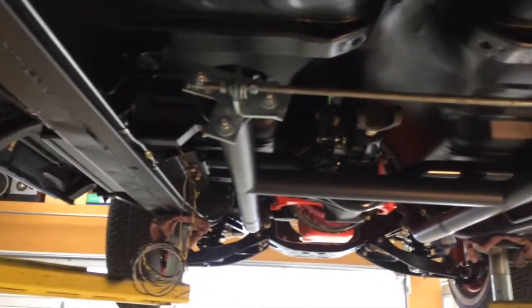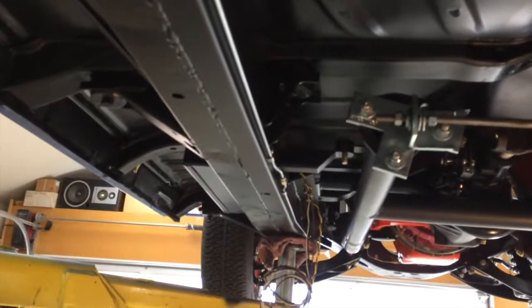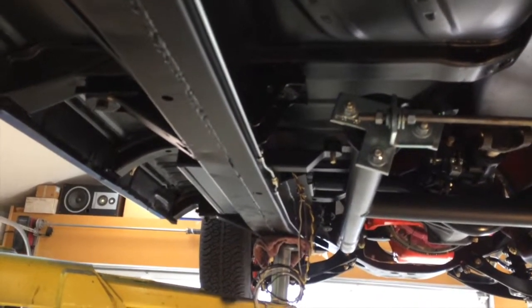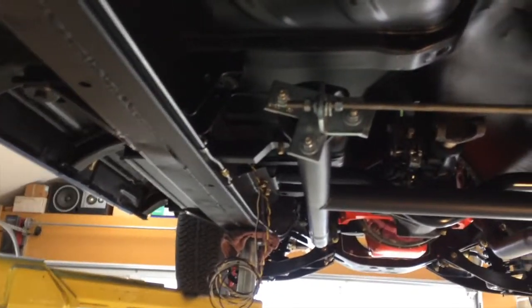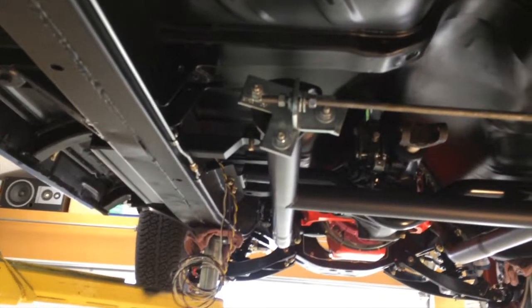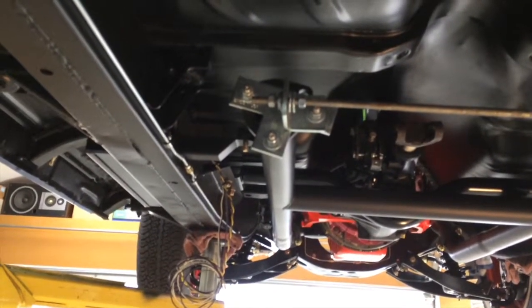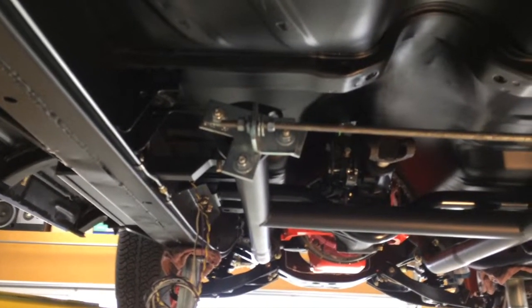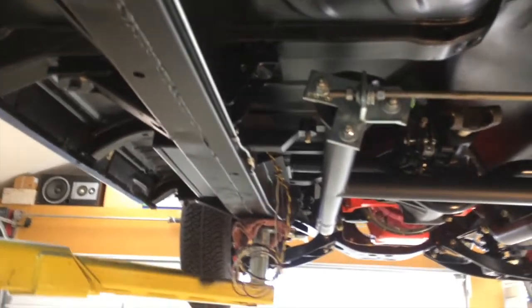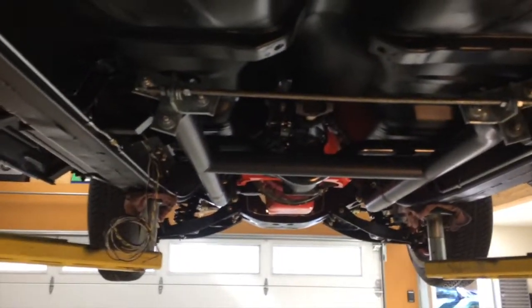And I noticed this morning, this one over here wasn't hanging exactly straight, like we had pushed it out a little bit too far. So I went the opposite way with the rod in between and pulled them together. I changed the dimension between the two flanges by about, I think, a quarter of an inch, and now it's hanging like it should. I'm going to wait till Scott gets here.